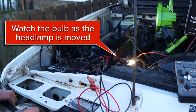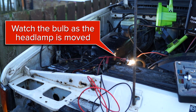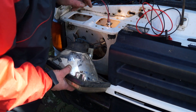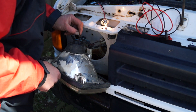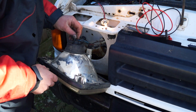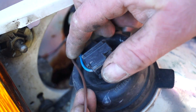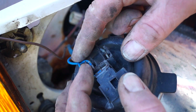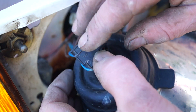The light hasn't flickered so I'll go down to the front lamp, because that's where the lighting loom runs. Remember this is exterior wiring. Also note if anyone has done welding that has melted wires together - it could be a while before it shorts out. I've actually found something - the light bulb has gone dim. It's a piece of wire that's been added to the high beam; it was earthing out. I can see where it's been cobbled in. Opening it up reveals an earth in there on the main beam cable - that was causing the problem. Problem solved.